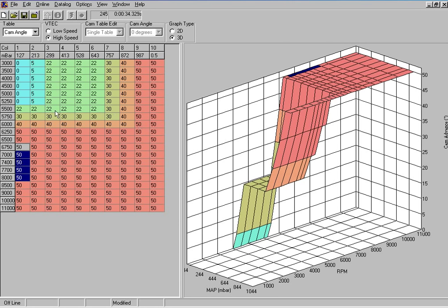When you're driving your vehicle, let's say you're looking now for power, you will accelerate and you will go right up the rev range. You'll probably change gear at somewhere around 8500 RPM. When you lift off the accelerator, you'll come back here, 85, drop down a couple of thousand RPM to say 6,500 RPM, and then go over here again. And this entire driving sequence, you're keeping the cam at 50 degrees. In this case, 50 degrees is required for a supercharger.